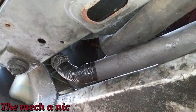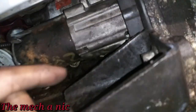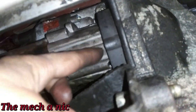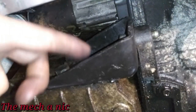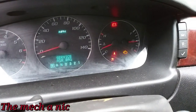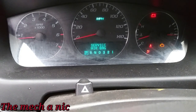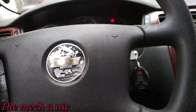Overall I'm happy with the job, and of course you have to remember to put on the little plastic shield for the starter. I can't tell you how many Impalas I've seen with that bracket and that starter shield missing. I just moved the car into the driveway and that's not good — we've got a battery light on and it's saying 'service charging system.' So more than one problem. Also, the power steering does not work.